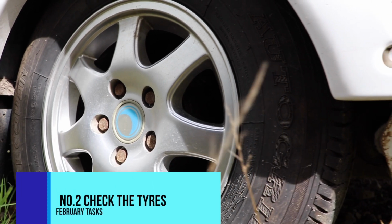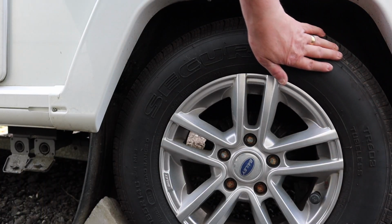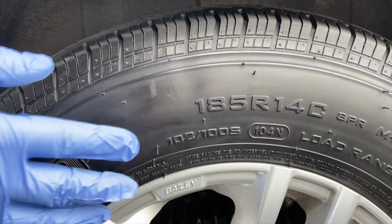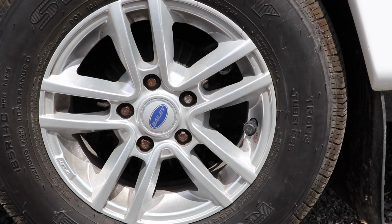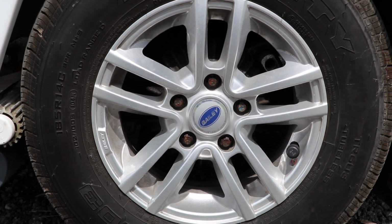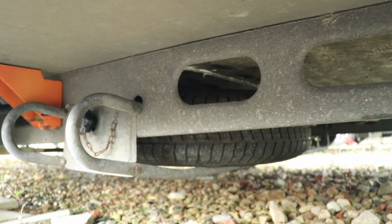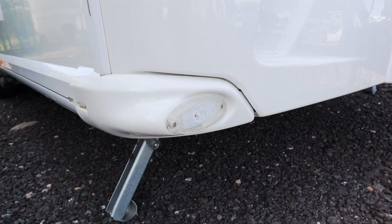The second check is the caravan tyres. Caravan tyres won't usually wear out, instead they crack. Sitting in the same position for months of their lives will cause the tyres to deteriorate over time. So checking the condition and pressure of the caravan tyres is really worthwhile. If the caravan has been sat for some time in the same position, consider moving it forward or backwards by 6 inches or so, just to redistribute the weight. Again, I have a video sharing lots of information about tyres. Link to that is again in the description down below.